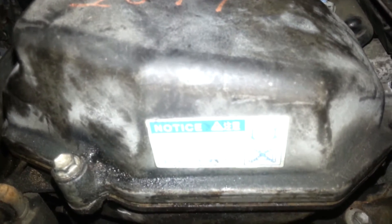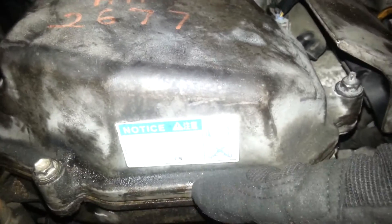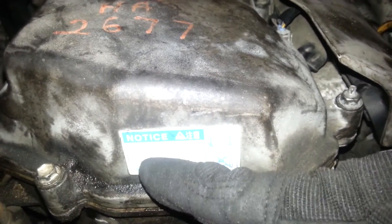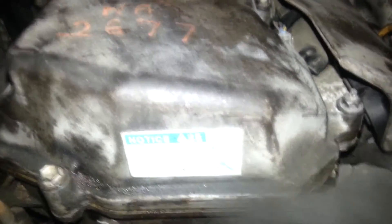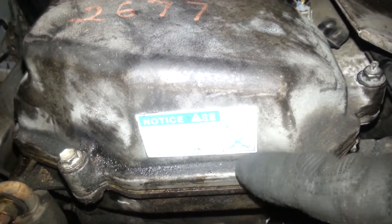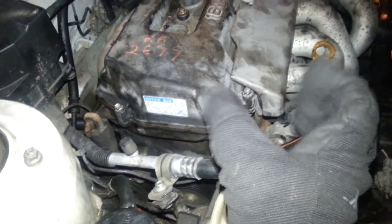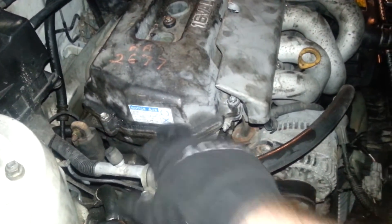Until one day I saw on the side of my engine that it said iridium. But they suggest twin ground electrode plugs — that's what came with it. I was like, oh my gosh, twin ground? I hate those. I know this engine will respond fine to these, but I'm very surprised to see this sticker saying it's supposed to be double prong, where it comes at it from the side, like a Bosch II, instead of the standard plug that everyone knows and loves.